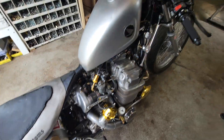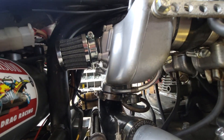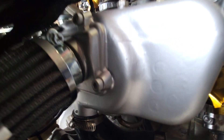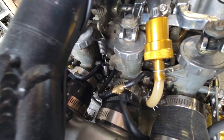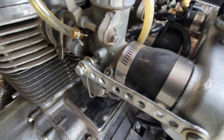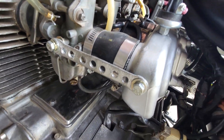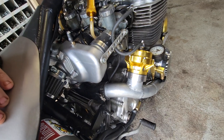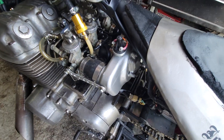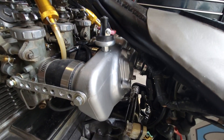The o-ring was not sealing, and it was leaking pretty good. Once again, sealed all that up — that's good to go. Carburetors: a couple of changes on the pitot tubes. Pitot tubes used to come up from the bottom, now they come in from the back. Flow comes up through here, splits off, and goes to all four carburetors, which provides the boost reference to the float bowls. This pushes fuel up through the jets when boost comes on. The system is now totally sealed from atmosphere — everything from idle air, mixture air, transfer air, once it comes on to main jet — that air is all provided through this plenum and the turbo.